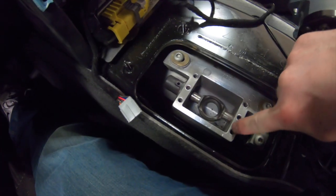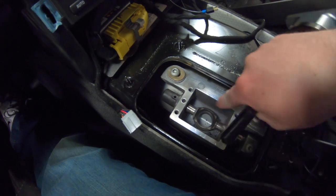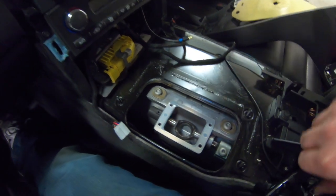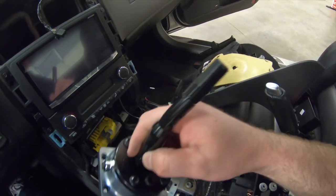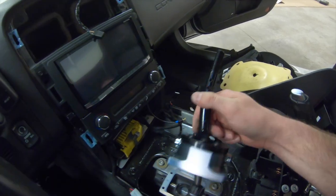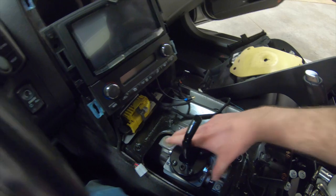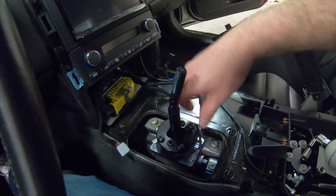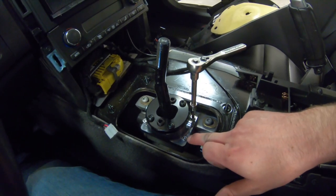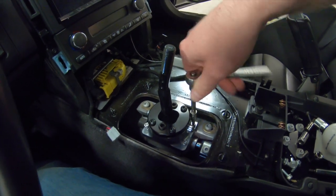All the stuff we're doing right now is putting this new plastic gasket in, and then this is all the hardware we'll use to fasten this to the car. I cleaned this surface with a Scotch-Brite pad and wiped it down with a little acetone to get all the old gasket material off. The gasket literally just flops right on. There's a part of the shifter machined flat on the front with threads, and the angle sweeps backward — we're going to install it just like that. The billet base has machined recessed areas where the heads of the Allen bolts go through, ensuring it's aligned perfectly over the torque tube.